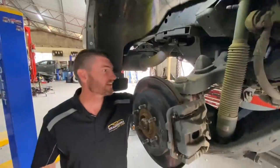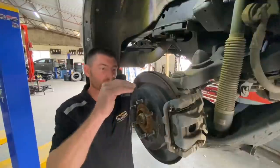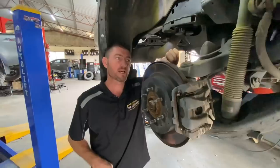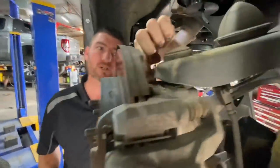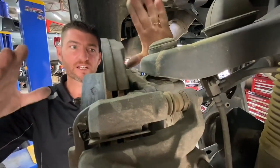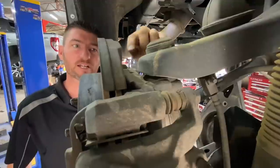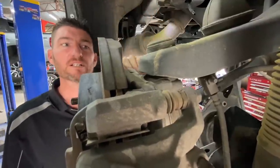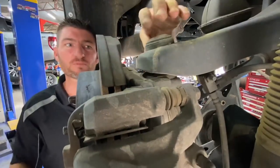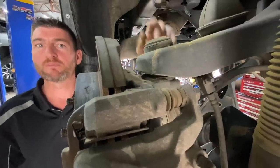If you get that little split pin undone just underneath and jack the rear end up, once it's lowered to the ground and safe, you can open up the mouth in that section and put a nice little block in there. When you lower that arm back down it wants to pinch and get very close, putting a lot of pressure on that ball joint to release it. If it doesn't work straight away, give it a little tap on the sides to give a shock and pop that ball joint - this has been quite successful.